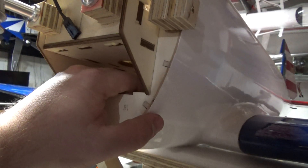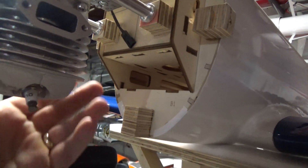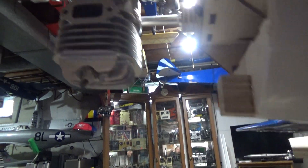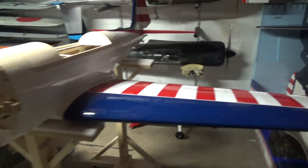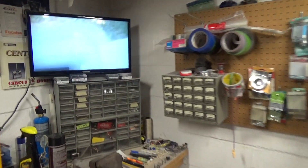Just little odds and ends left to do — building the gear, building the gear fairings, getting the wheel pants set up. I can't finish the cowl until I figure out what I'm going to do for an exhaust. I'm taking advantage of this nice little tunnel in here — plenty of room to put my ignition in there. I already showed you on the last video I had the cutout for the ignition wire. This tunnel is really nice because it goes into the fuselage and because of the way I have the wings mounted, with those little holes in the bottom, air that comes in through the cowl through the cylinder now has a pass through the fuselage and exits out the bottom — good enter and exit air.